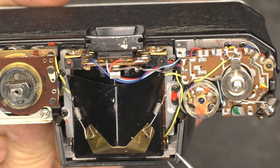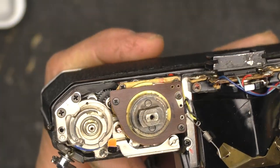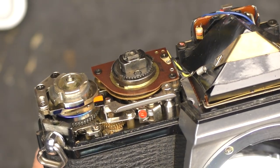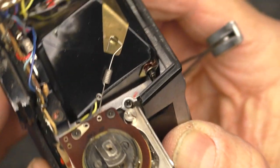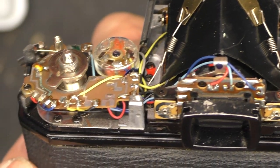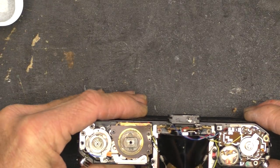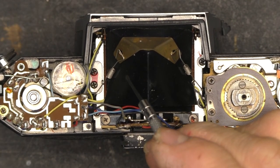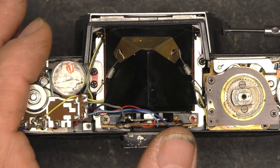I've got to find out where the meter is. After a bit of looking around on the internet, I discovered that I need to take off the prism — the light meter lives down underneath there. The prism is held on with two springs and a couple of screws on the side that pinch and hold it in place. This piece of trim needs to get out of the way first.